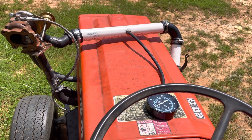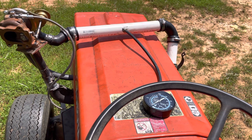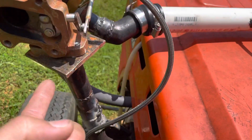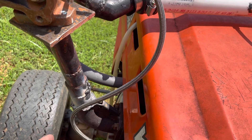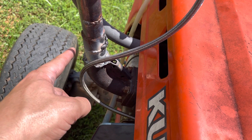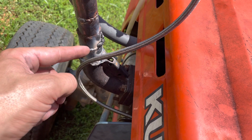The PVC charge pipe is obviously about five or six bucks. The flange we made here is made out of flat stock. We just had a bunch of exhaust pieces that we put together to make it work. Already had the supply line, and then of course we used like a 0.8 millimeter flux core wire to weld all this.